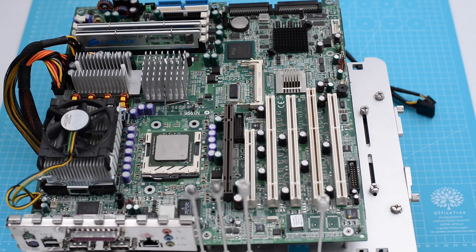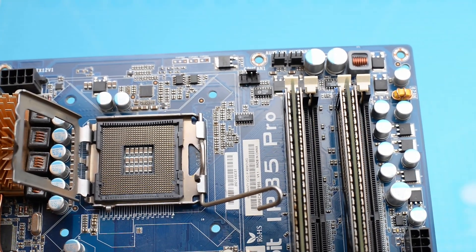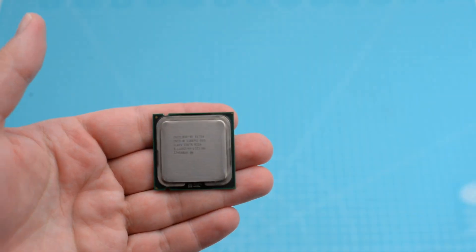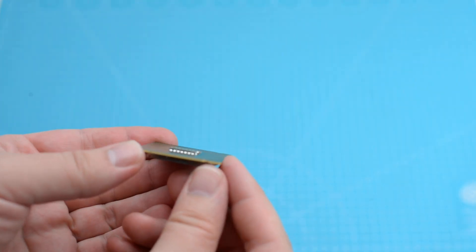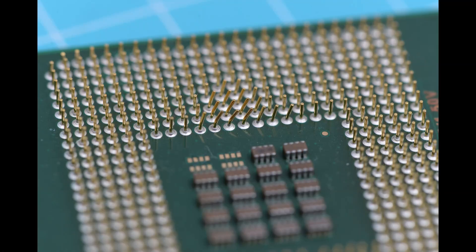Fortunately, I was able to push the CPU into an almost closed socket without any damage to either CPU or socket. You can see me here finally figuring out the position of the lever and fixing the CPU in place. So remember, you should never do it like this. My personal experience with retro motherboards and CPUs is that I prefer bent pins on the CPU rather than on the motherboard. But if a motherboard fails, it is usually due to something else rather than bent pins on the socket, so this is not usually a real concern. There is one issue I have with LGA type CPUs: they have small electrical components mounted on the underside surface of the CPU, like capacitors, and I've seen processors with these components damaged. So that's another thing to be aware of with LGA type CPUs.